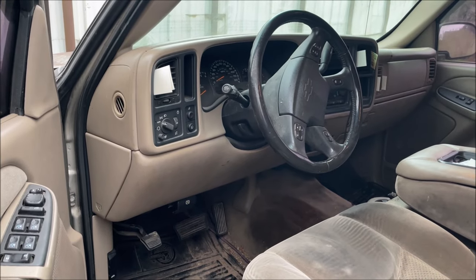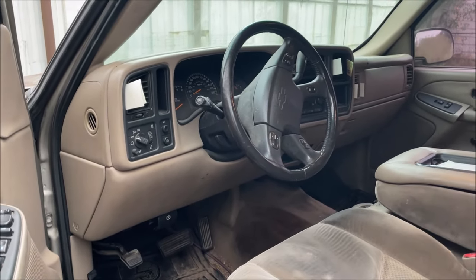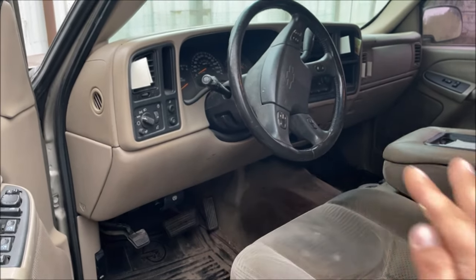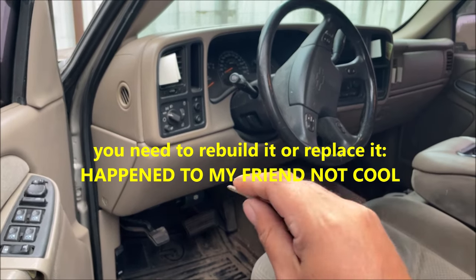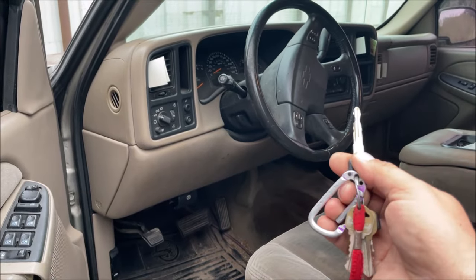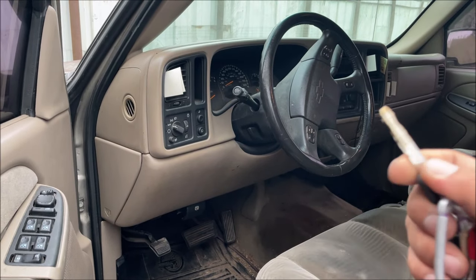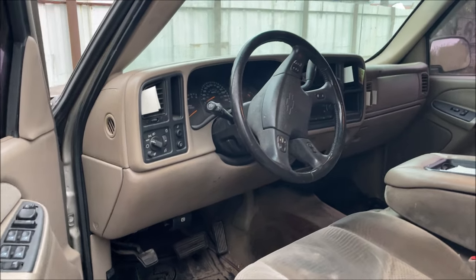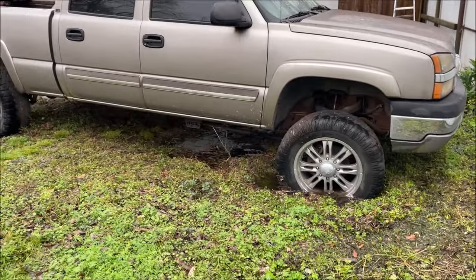For those new to cars, that sound can be two things. Sometimes pressure regulators fail and fill the bores with gas, washing out the rings — the engine loses compression and makes that same sound. But you'd feel the engine vibrating. When we heard that sound with no vibration, the engine is not spinning — that is the starter free spinning. It could be a bad solenoid.